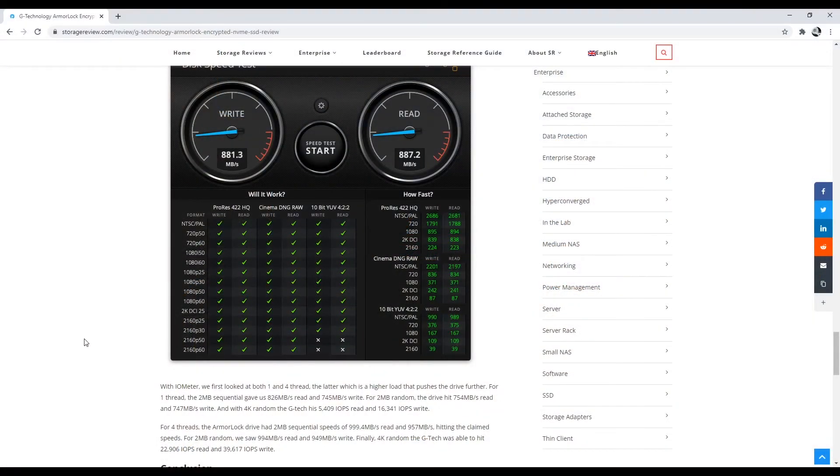Performance is part of the story too, because as Vince was saying, shipping drives around a high-density place like Manhattan — putting it in a courier's hands — is basically sneaker net. On the performance side, it performed pretty well: single-threaded operations were in the low 800 megabytes per second read and around 750 write. Bumping to a four-thread operation got it to about a thousand megabytes per second read and 960 write, basically saturating the USB 3.2 Gen 2 interface, which tops out around one gigabyte per second.